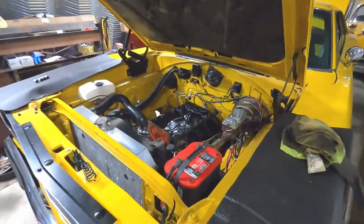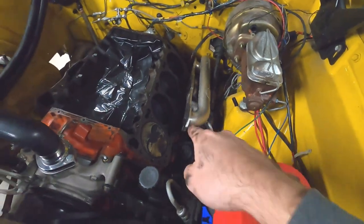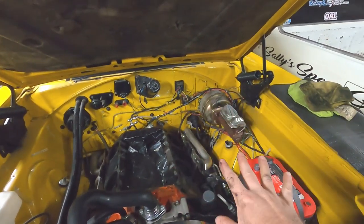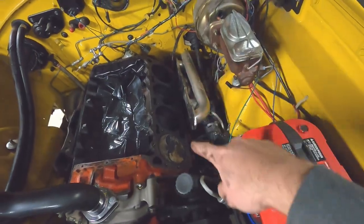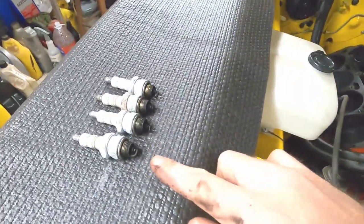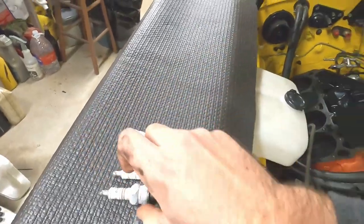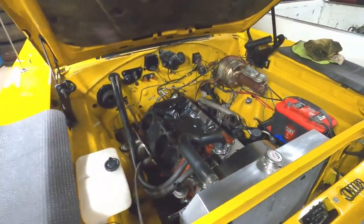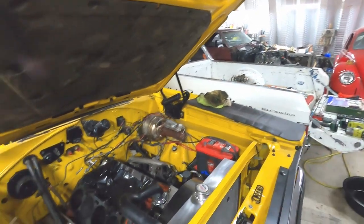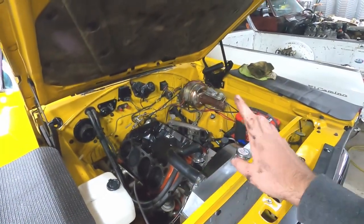Got the old cylinder heads off the engine and out of the way. Now we have room to clean up the surface of the block as well as the flange on the header. Had to remove the exhaust collector bolts underneath and separate the exhaust from the headers to get to those bottom bolts for the heads. Based on these spark plugs, this thing was running like garbage - look how fouled out and carboned up that plug is. For an engine that only has 300 miles on it, it definitely needed some attention. I think I'm going to have to do some work on the carburetor because it's pig rich and fouling plugs.